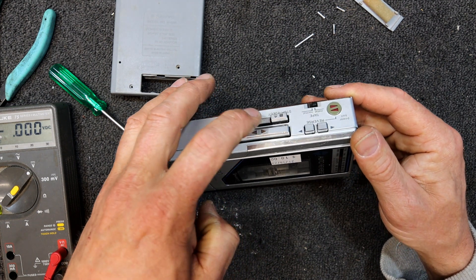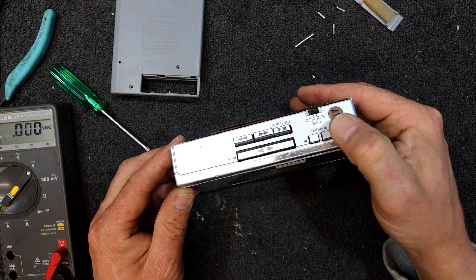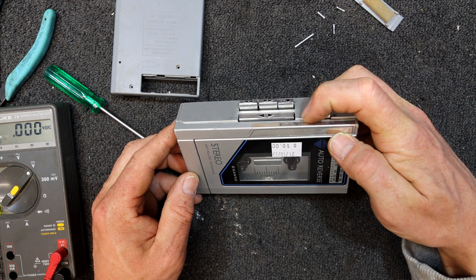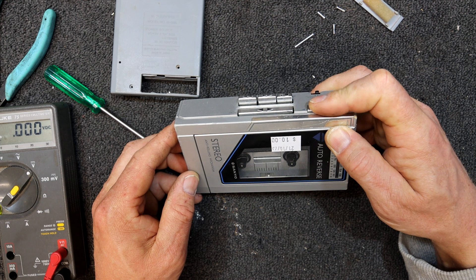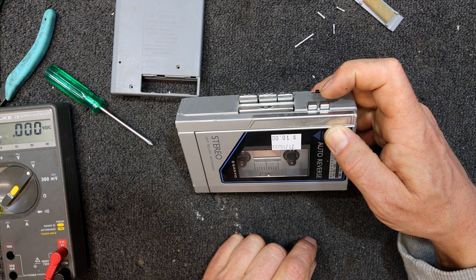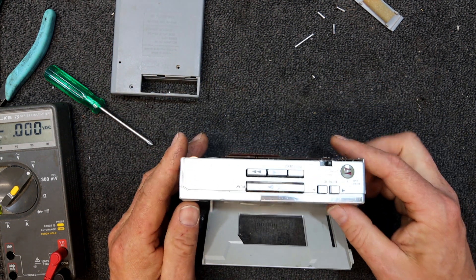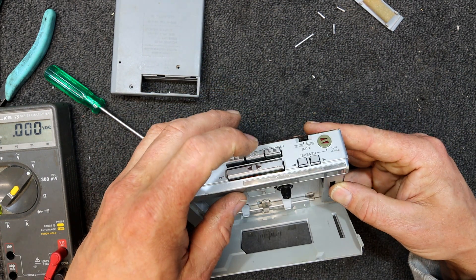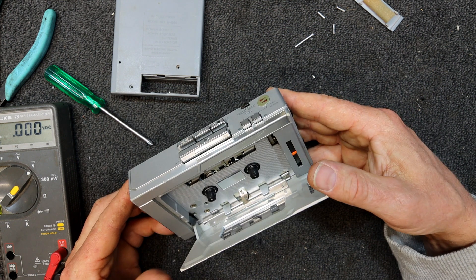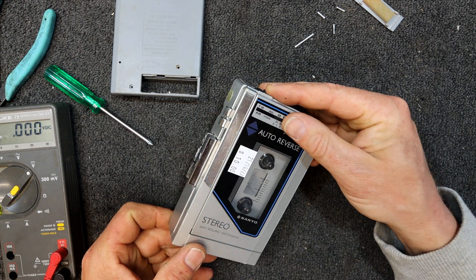Always double check the batteries — normally with these you'd have a power adapter ready to go. They're a little low but I think they're alright. Bottom one positive — the springs are usually the giveaway and they're in series normally. That was it maybe! We've now got take-up, rewind, fast forward. How do we change direction? That's reverse. They're both going in opposite directions — that shouldn't happen. Oh, it's just a little eject lever that pushes on the tape, so if you haven't got a tape in there there's nothing to push the door.